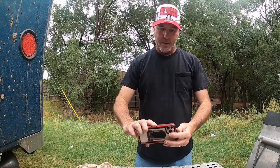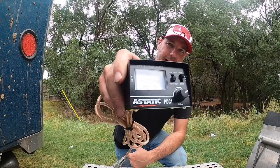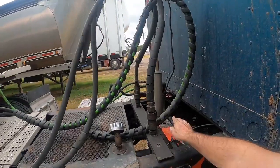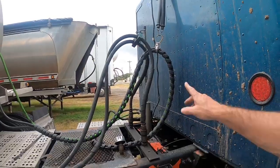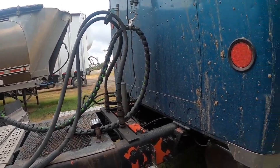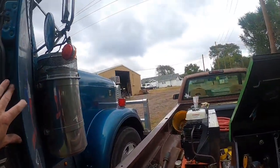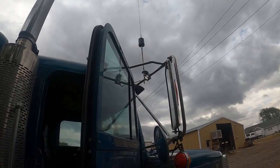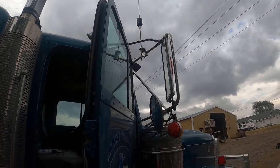We're going to take this shitty cobra out of Adam's truck and put in the Connex. I got a static SWR meter here in the jumper so we can set the SWRs and make sure they're good — they need to be below 1.5. This truck used to have a 102 whip but we took it off because there was too much stuff for it to hit. We were going to get a Wilson or a K40 Trucker 2000, but this is a knockoff version of those antennas. Hopefully it won't be too hard to tune.